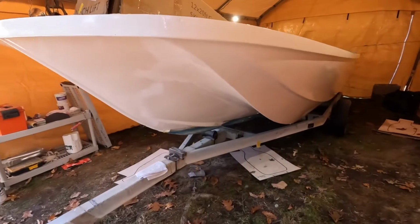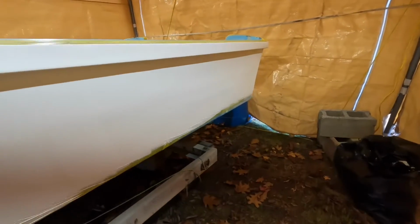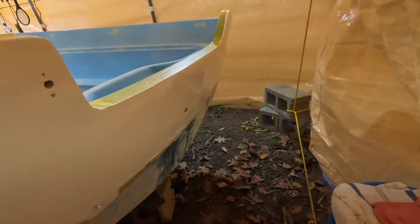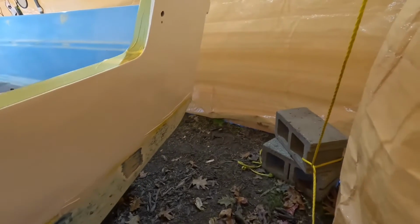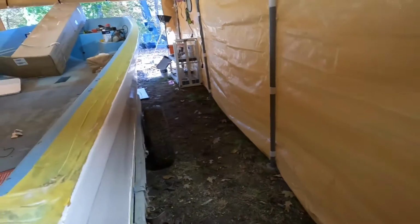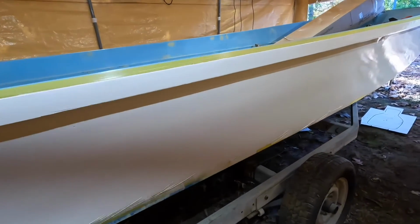Okay, third coat is on. We are done. Got to see how I got to this point with the rolling and tipping. It is true what they say about paint like this. This type of paint is definitely thinner is better. Don't put it on heavy. I was making that mistake along the way, even on this third coat, just trying to cover it. I wanted the areas that were thinner to be covered, but that's just not the way to do this. Putting it on thinner is better.